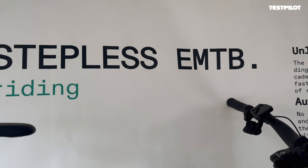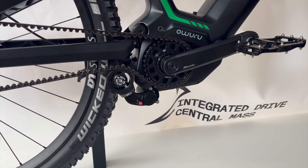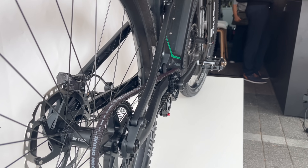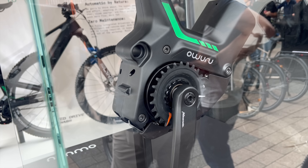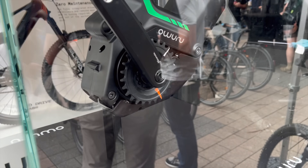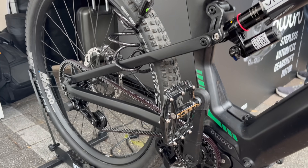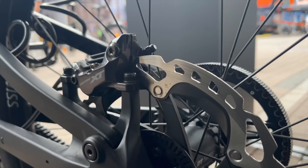E2 Drives had a bike there with an URU motor, and that made quite a lot of noise at the show. It's a motor all about constant velocity — it maintains a constant cadence so you're able to keep pedaling at the cadence level you set and the motor will adapt. It's a motor-gearbox drive unit, meaning all that weight is centred around the bottom bracket. It will have a belt drive, which removes unsprung mass from the rear wheel and centres the weight in its gearbox-like system over the bottom bracket. That's important because we don't want too much weight on the rear wheel — it makes the suspension perform better and keeps weight balance low, giving you great manoeuvrability, a little like the GLP3 from Lapierre. I expect this bike to take a while to get to market; don't forget you'll still need the same battery weight as other systems.